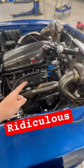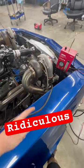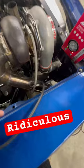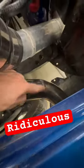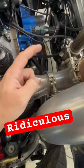I wanted to check this side of the engine to see if there's any exhaust leaks that would cause the O2 sensor to read weird. I hooked up my smoke machine to my tip right there, and it turns out I have an exhaust leak down there — right here at the v-band flange. You can see it rolling out right there.